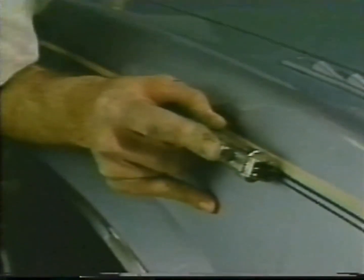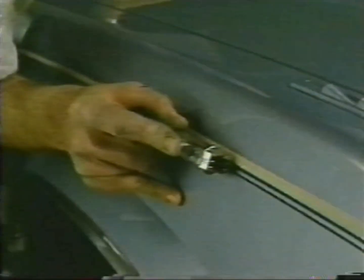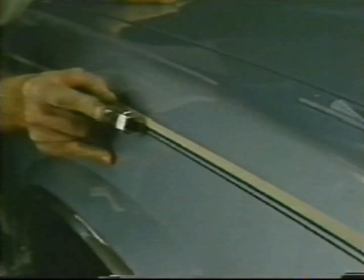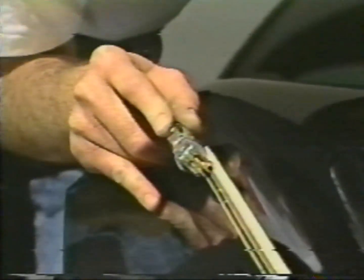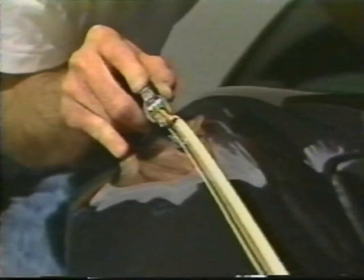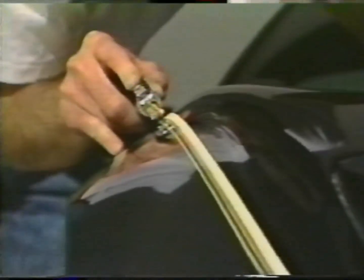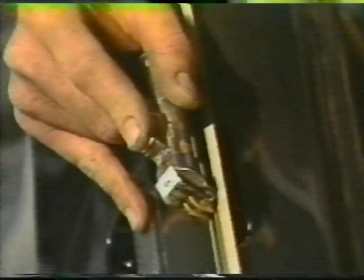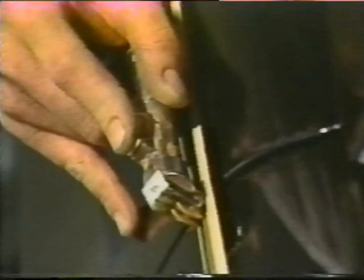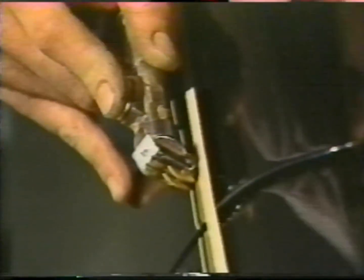The double wheel head is ideal for use where a standard single-color double stripe is called for. With the little finger as a stabilizer, the double head creates the perfect effect you're after. Here, masking tape is used as a sight guide to ensure correct alignment to the car's body. To keep the Beugler tool flat, let your little finger lightly slide along as you move across the surface with the index finger holding the wheel in contact with the surface.